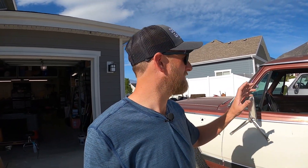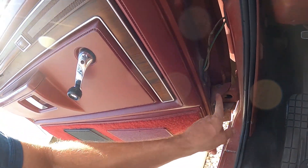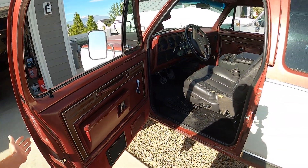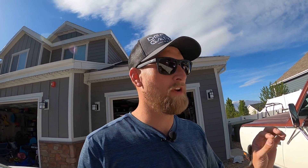I'm going to start out first by telling you guys something. Last video or maybe two videos ago we put new door seals on the OG Crew Cab - they worked excellent. I had the same brand new door seals to put on this truck. The rear doors were perfect, but the front doors would not shut. I asked around on Facebook and found out because they're so bulky being brand new, I had to make an adjustment to the striker pin, and also had to adjust the hinges so the door sits out just slightly further away from the cab. They wouldn't shut at all, but now they shut perfectly. So if you order those door seals and you're having a problem with the door shutting, make sure you adjust the striker pin and the door hinge just a little bit. I think as the door seal wears in, I'll be able to pull back on some of those adjustments, but for now it made it work. I'm still very satisfied with the product.